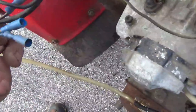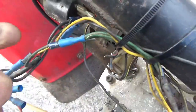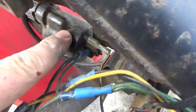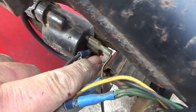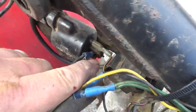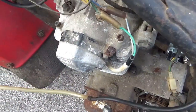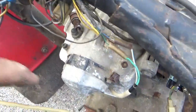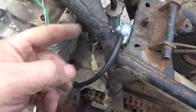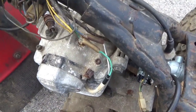All the wires are hooked up. Particularly this ground wire — I'm not sure why it was disconnected; that might be the only thing wrong with it. With this particular year ATV, I have a tendency to make sure the spark coil is grounded, the frame is grounded, the entire circuit — hopefully the motor's grounded. Sometimes I have to run an extra wire from here to the motor to make sure it's grounded, since it doesn't always pick up ground through the mounting bolts when they're loose.